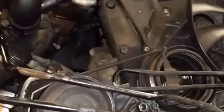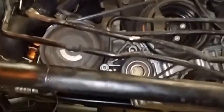Right here, you gotta make sure this is going in properly, because there's these two little notches in there that should fall in place, and so is here. This has its own little notch too. That thing right there, on both sides. Well, this piece is covering it, but anyway, you gotta make sure that's both aligned before you finally torque everything together. And if your engine is too high up, I would recommend undoing the chain just one link, and putting it down just a little bit, but not where it's resting on the subframe already, just a little bit above, but not too high.